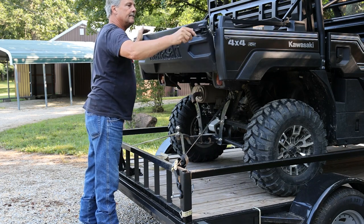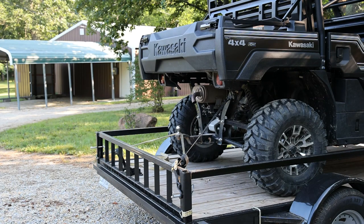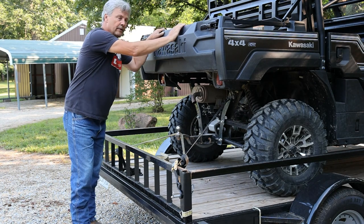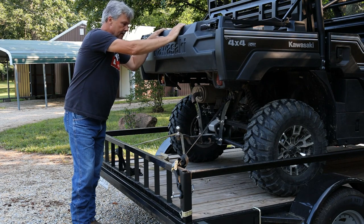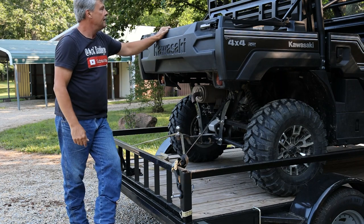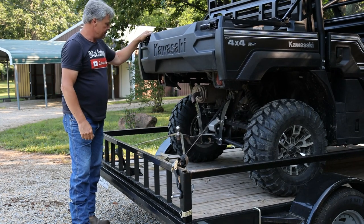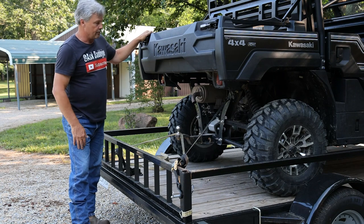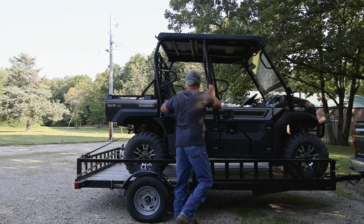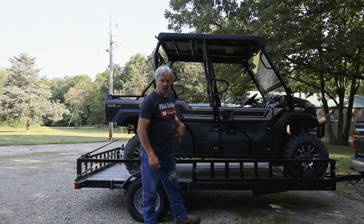I think this is ready. The mule is rolling in right at 1,900 pounds. By the time we put a little bit of gear and different things in here, it would not take long to match what the axle on the trailer is capable of towing, so you want to be mindful of that. You can probably be a little bit heavy, but not much — you don't want to be dealing with axle bearings out on the road. I think we're loaded up. I do leave it in reverse on the mule and the parking brake is set.